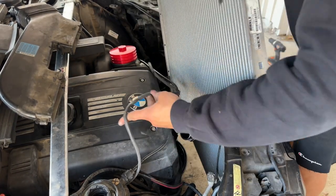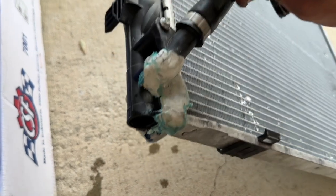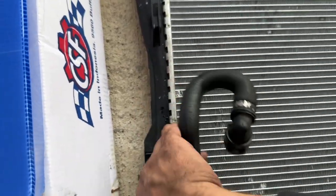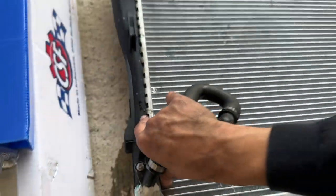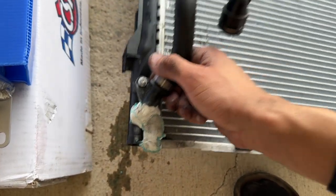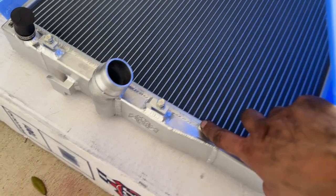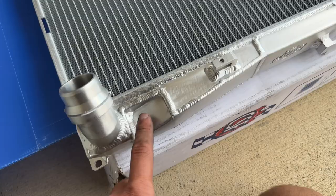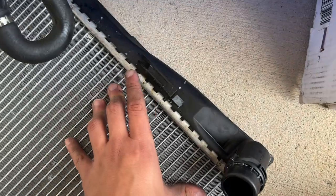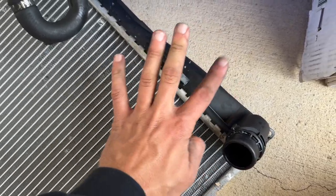And there it is — this is exactly what I was talking about. Look at this OEM radiator: it's plastic. You can see where I JB Welded trying to fix a leak, but plastic does not hold to metal well. BMW uses little clips and adhesive that just doesn't do a good job — no matter what you do it leaks. I replaced the O-ring, which is a very common leak point, but it still failed. This radiator here is only four months old — no exaggeration — and it's already done.